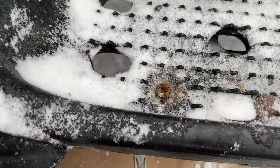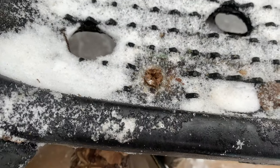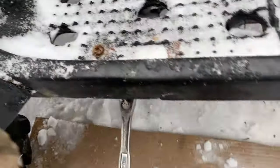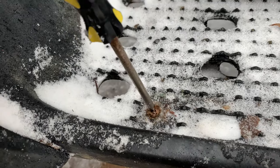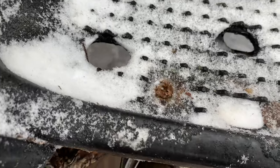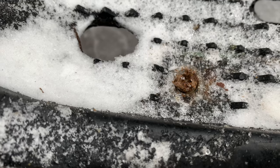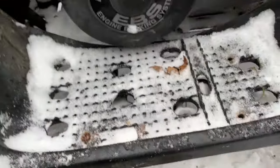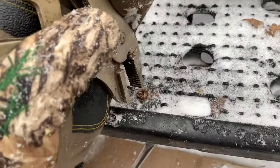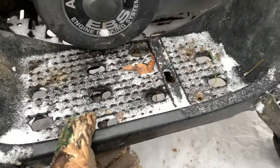We're going to start taking all these bolts around this cover off. All these flat sets on top that you have to hold while you put your 11 millimeter on the bottom and loosen — they're all just going to turn. What I do is get it started with the Phillips head. See how it's all rusted out? It should give you just enough to get it going. Then you can push it up on your ratchet, leave a little bit of head space, and get your vice grips on your Phillips head to hold it while you loosen. You've got four 11 millimeter bolt sets.